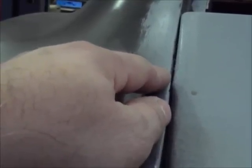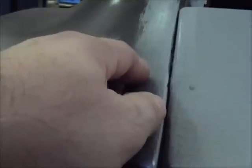I know I've got to seam seal it. It's already welded on the inside, but this is kind of an area that I haven't really played with a whole lot. That is a good, nice way to do that, because that definitely needs to be dressed up better. And I don't want to put any filler in there because that could crack out. So I think guys probably weld those up, and then maybe they put a little filler over it and work the filler out, you know, with a piece of 80 grit or whatever. So let me know what you think on that.